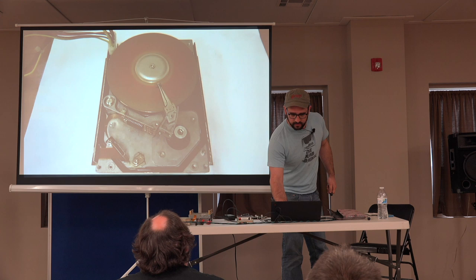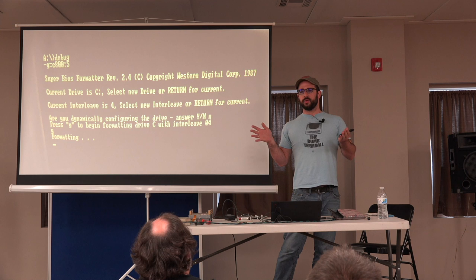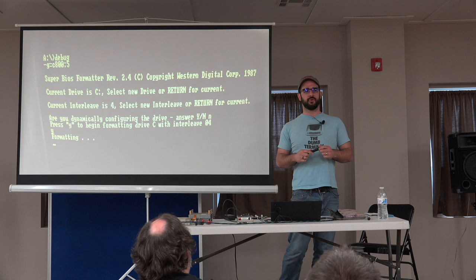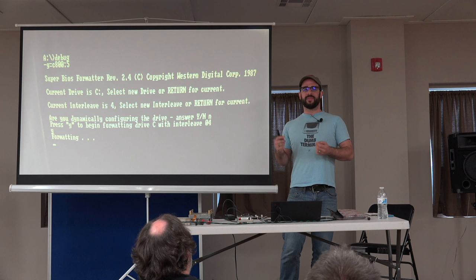All of these original drives, when you would go to set them up, you would need to low-level format them. That's a term that gets misused a lot, because you'll hear, oh, I got my new hard drive, I went into DOS, and I low-level formatted it. Well, that's not what you did.